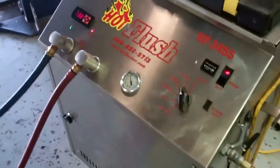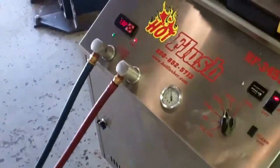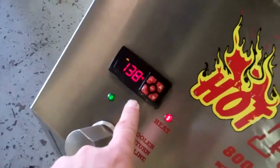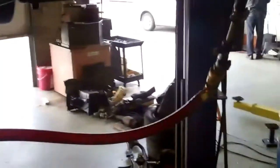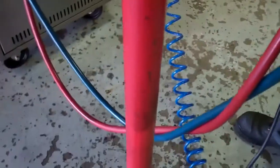This is a demonstration video of our hot flush machine. Now, this isn't your vehicle — this is just an example of how it works. The fluid in here gets up to 190 degrees; right now it's just warming up. You can see the lines come out and the fluid's going through here. Where it's connected here, this is actually connected to the cooling system portion of your transmission. You can see where we've attached it, and it's going through the lines right up through here, flushing all that bad fluid out. So when we put your transmission back in, there's no more contamination.